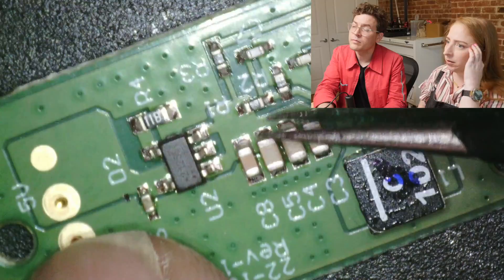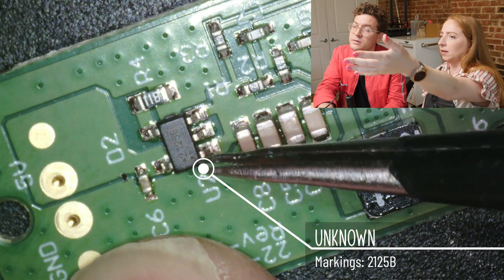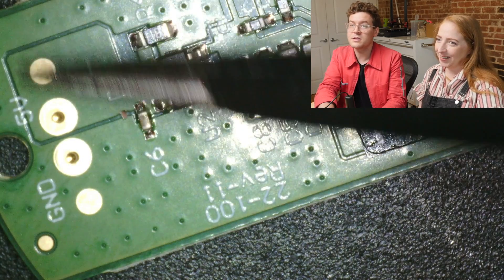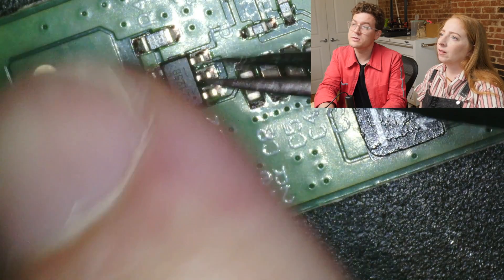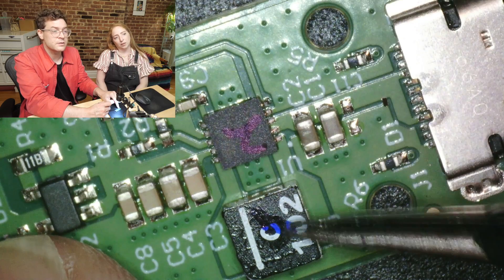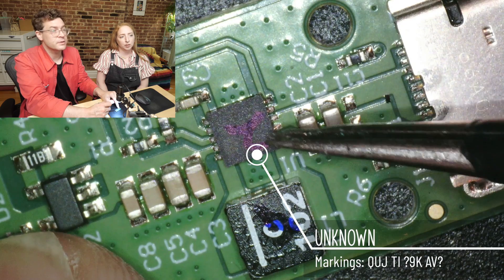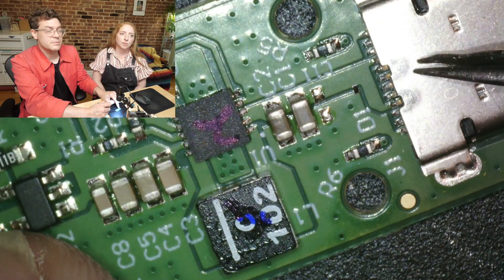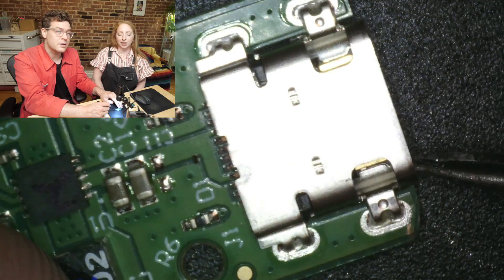Components 12 and 13 are on the charging base circuit. This looks like a voltage regulator — you can see it's got all these decoupling caps, and voltage regulators often look like this and often come in that package. You can see this looks like a ground plane here, and it says ground and five volts. So there's a big square of five volts here and ground here — that's giving us five volts. And if this says L1, that L means inductor, so this is also probably an inductor. There's also a microchip here — probably because it needs to detect when it's plugged in, some kind of USB-C controller slash power chip. I really like the inset USB-C connector because it makes things really skinny.